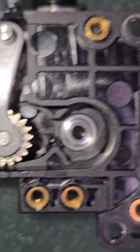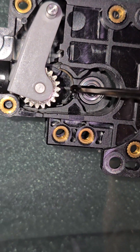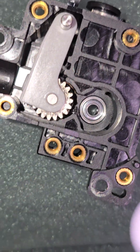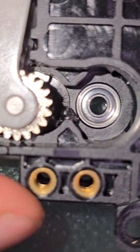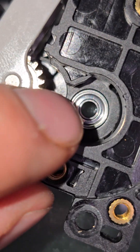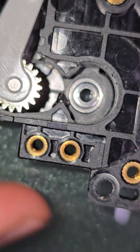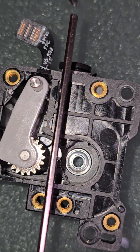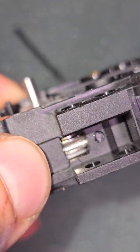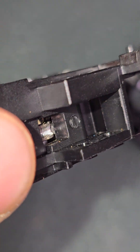It just got bunched up in there. This is basically the ground-up part of the filament. I don't know if there was a lump in the filament, but if you look, this is actually the root right here - this is where your filament goes through. Right here is where it caught up on the gears and just started getting smushed and pushed. This is where it cut at the filament cutter - the filament cutter goes through that channel right there and cut it flush.